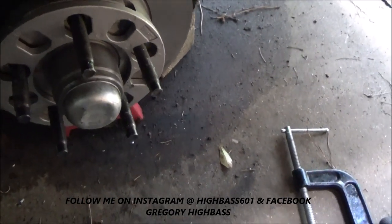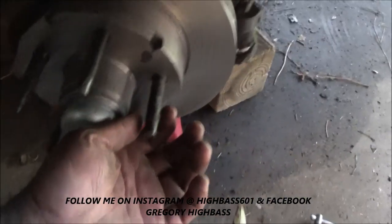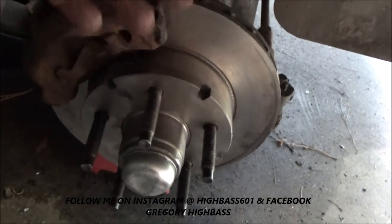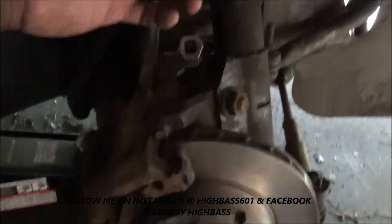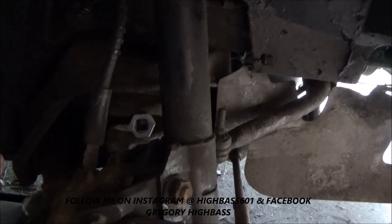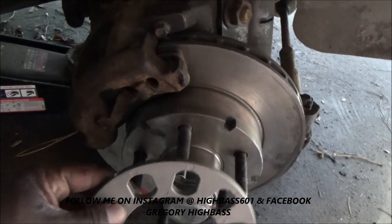Okay guys, I've got one installed. These are my spacer plates that I'm going to run — that's why I got the extended 3-inch studs. I was test fitting my 17-inch wheel and I had probably less than half an inch between the strut and the back of the rim — it was almost touching but wasn't. The rim I'm putting on has the same high 30mm offset, so I'm going to use these plates to push the wheel out.